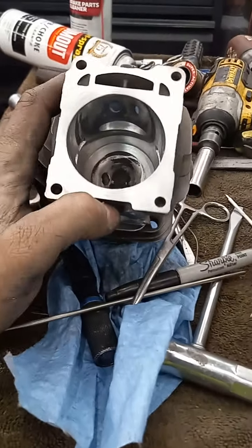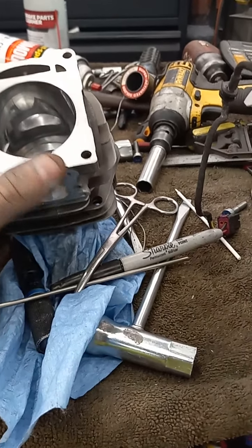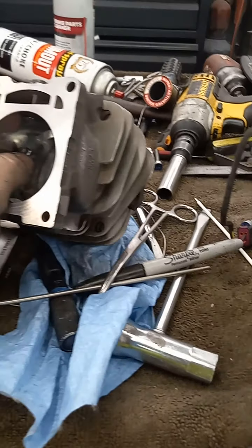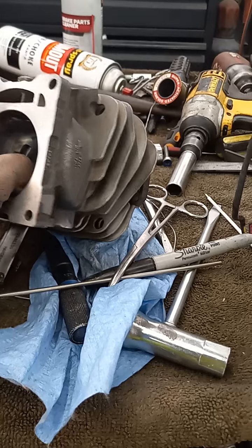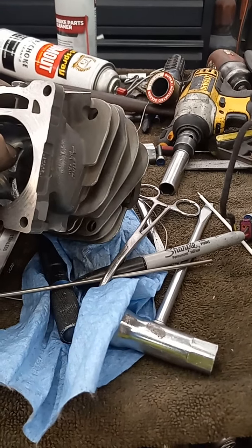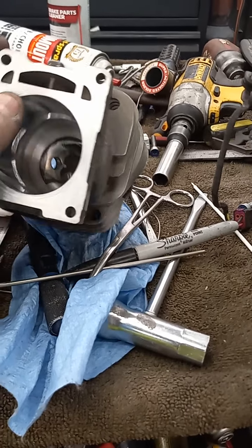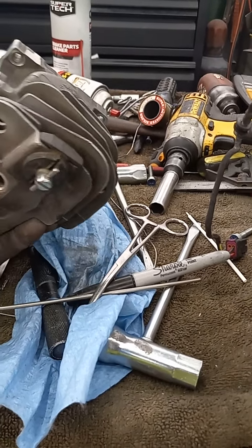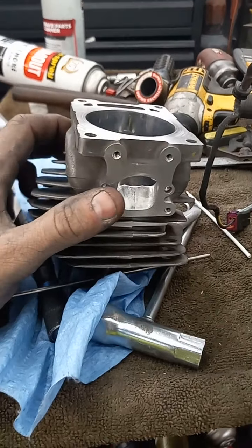The numbers on this — I'm hoping they're gonna work. I went with my standard 102 on the exhaust. The transfers were staggered to begin with and tapered weird, but I more or less squared them up while still keeping them staggered. I'm at 18 and 23 degrees blowdown on them. The intake's at 88. Really not much I can do about that — it is what it is.